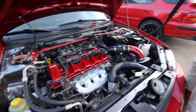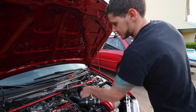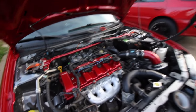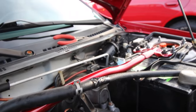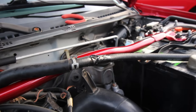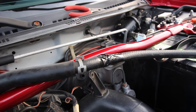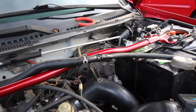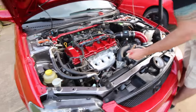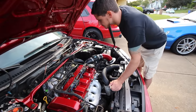My tape's leaking a little bit. Yeah, it's leaking from the hose. What you're looking for is smoke somewhere in the engine. You'll see that. So it's leaking right there. Oh, it's difficult to see smoke. Oh, okay, so you can see that. Oh, that line's good. You see it anywhere else though? No. I don't see it anywhere else either.